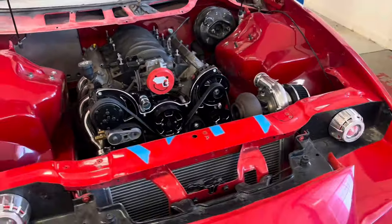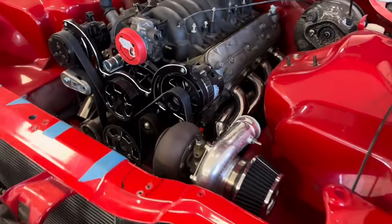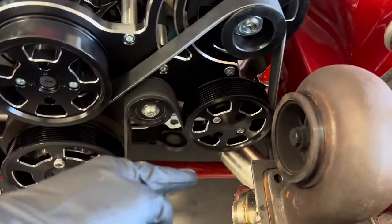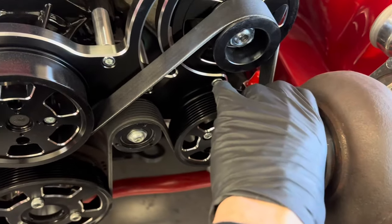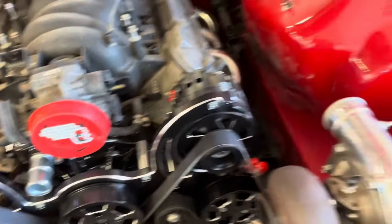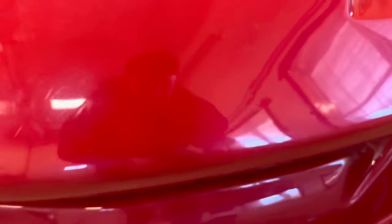Under the hood's the fun part. We've got a Turbo LS1 — we're going to run about 10 pounds of boost to it. Tyler's been getting some piping and mounting things, getting that all ready to rock and roll. We've got some headers that fit on there real nice. Three-inch out down through here, we're going to have an intake, and the charge pipe's going to come up right into there. And this one is going to come out and down through here to the intercooler right there.